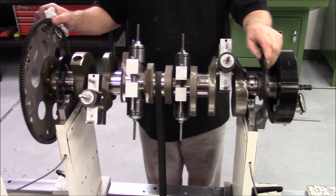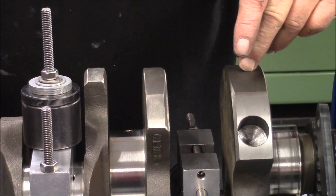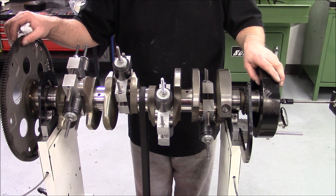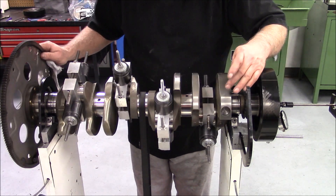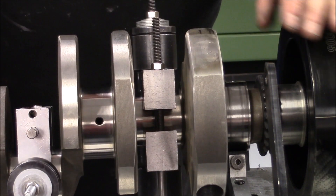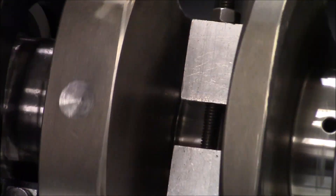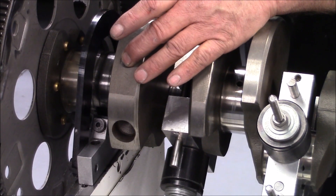When we set up to do this we wanted to finish with weight being pulled out of the center of these counterweights front and back — not out here, not over here, but in the center — because this counterweight was right in the center and we wanted to take the weight out of it so it would take stress off the crankshaft snout. On the front counterweight we just made the factory hole deeper. We had to fill one hole in — it's been welded up and ground smooth. On the back, there was a factory hole that we filled in with a weld and ground smooth, then we drilled one last hole to fine tune it.